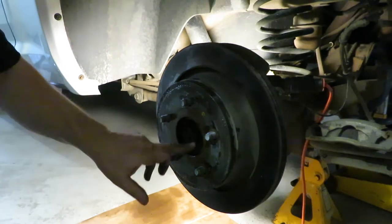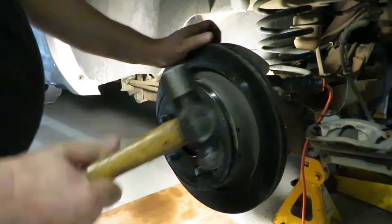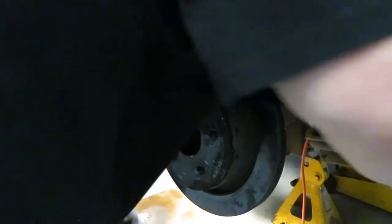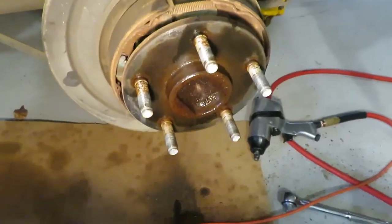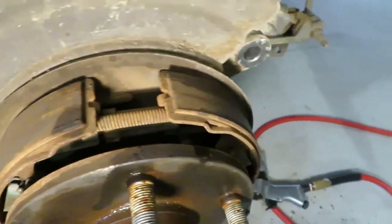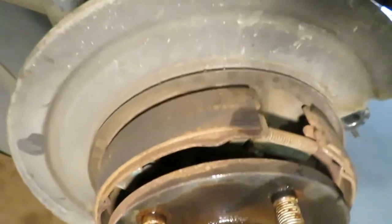She's coming now. Because I'm not going to reuse the rotor, I'm tapping on the actual rotor surface — normally you wouldn't want to do that, especially if you're going to reuse the rotor. That was a bit of work, but probably not as bad as it could have been. Here are your emergency brake shoes, and as long as they haven't been dragging, they shouldn't have worn out hardly at all.